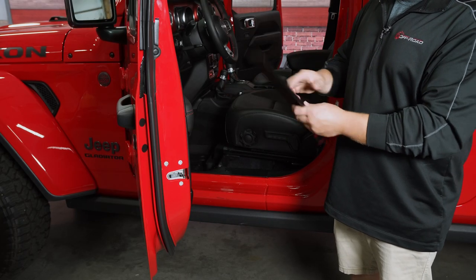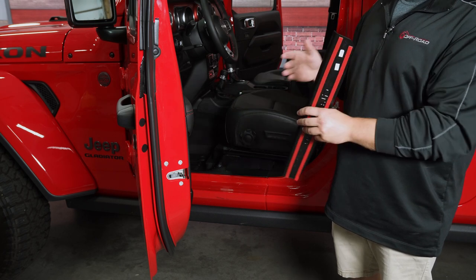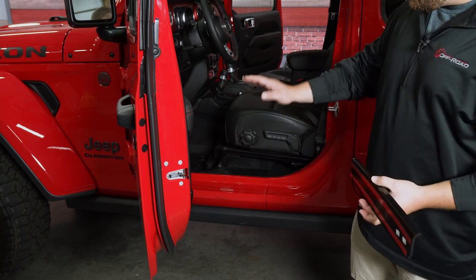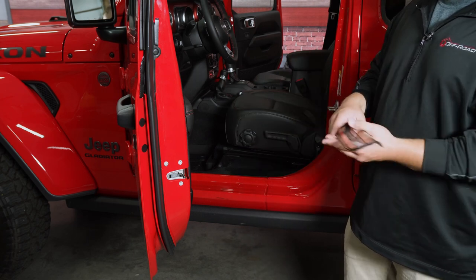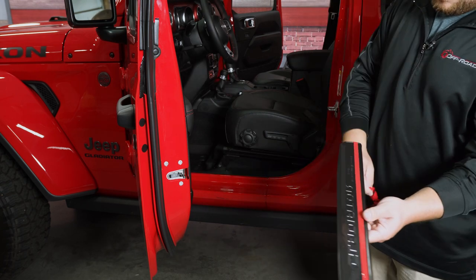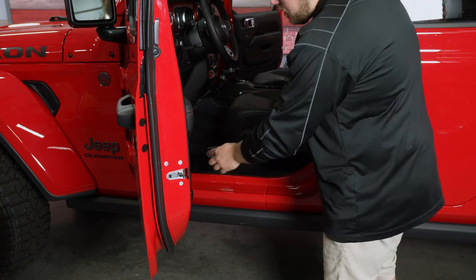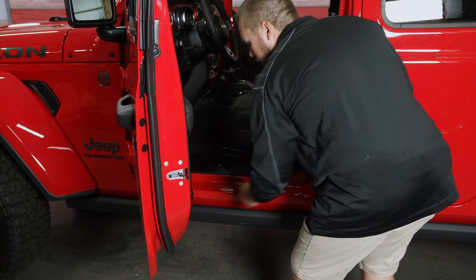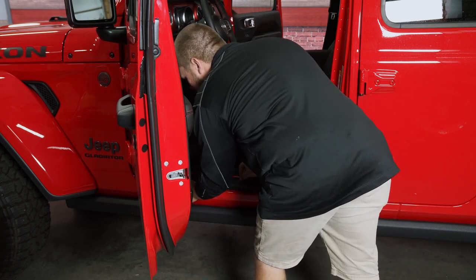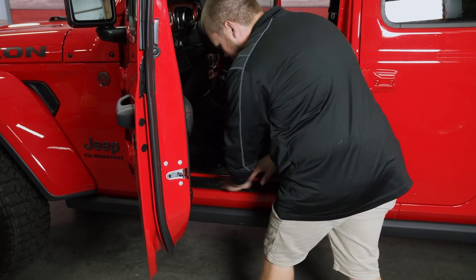We're going to go ahead and grab the front left side. Now if you look on the back, there is a side that says 'molded sill plate front left.' Left is going to be the left side, that's left hand drive. Make sure you look on the back for each of them as they are marked for you. Now we've let that alcohol sit on there for about five minutes so we can ensure it's completely dry. Mopar gives you a little tab to pull the 3M — we're going to pull the backing on each of the 3M pieces and then we're going to line this up. I like to line the front side up with the indent right here, and we'll go ahead and get that lined up right to the edge, then push it towards the back so it's fully towards the back and give it a firm press all the way down.